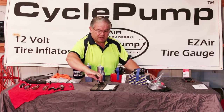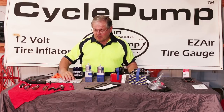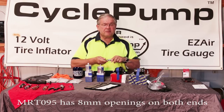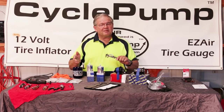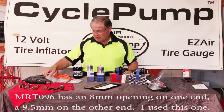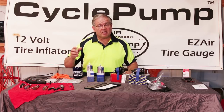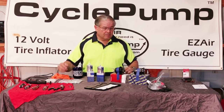You'll also want a set of calipers. For my 800GS, the indicated part from Googletech is the MRT095 — it has two 8-millimeter diameter openings to fit onto the fuel pump and canister filter. However, my particular bike had a 9.5-millimeter pump outlet so the MRT095 wouldn't fit, but the next size up, the MRT096, did fit. My counsel: do the preliminary process when you have downtime, take out the assembly, measure it, then order the kit so you don't get the wrong one.